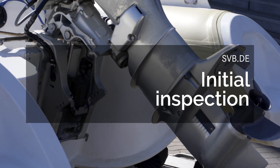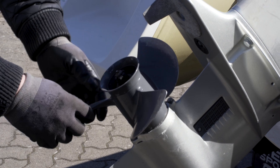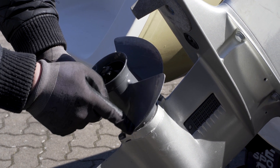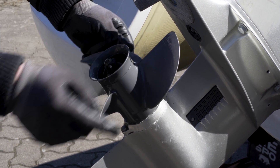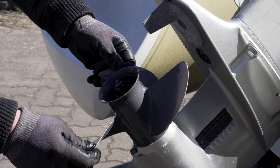The first thing to do is take a good first look over your outboard motor. Check the propeller for damage and make sure it can move freely. Damaged blades can cause the system to be unbalanced and shake, leading to increased strain on the engine.